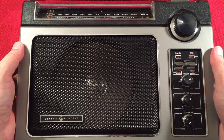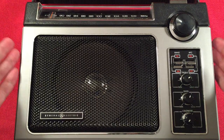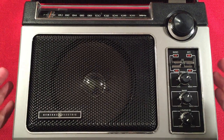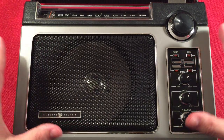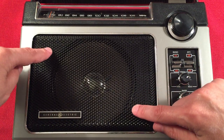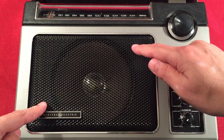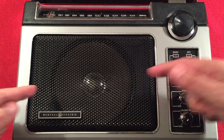Down on the front here is a metal speaker grille — pretty neat setup. This radio came around $45–$50 when I got it. It took a little bit of cleaning, but it cleaned up really nice. Typically people use this as a shop radio, so it had paint on it and everything else, but I was able to get most of that cleaned up. The speaker here is 6½ inch — it measures 5 inches at the cone, but with the flanges it's 6½ inches, and I checked some service manuals and they confirmed 6½ inches.